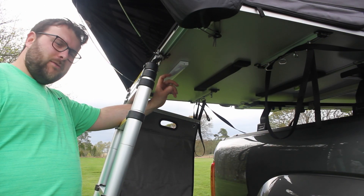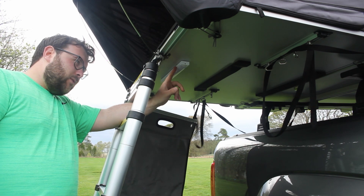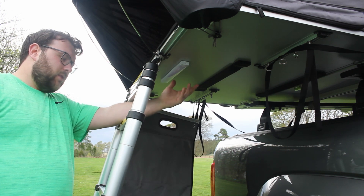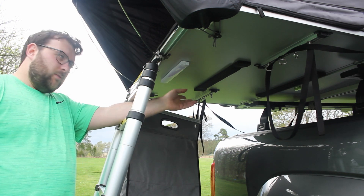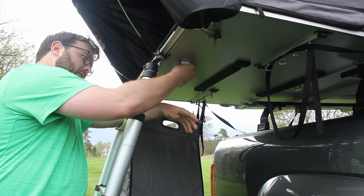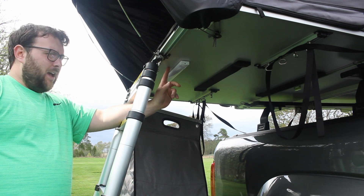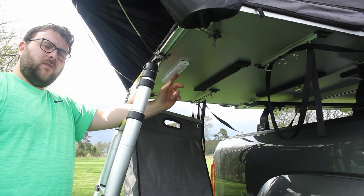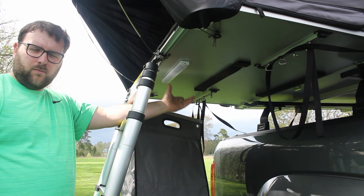Mod number four is tucked away under the ladder — it's a PIR or motion light attached with a magnetic strip. In the middle of the night when you need to go to the toilet, as you swing your legs out, the motion sensor activates and the light comes on, giving you a bit more light around the ladder to find your shoes. This one is USB rechargeable — press it once for motion-activated mode, press again to stay on permanently, press again to turn off. It's removable and magnetic, and it can live in there when the ladder is shut since the foam pad is deep enough that the light isn't interfered with.